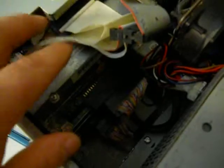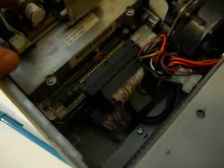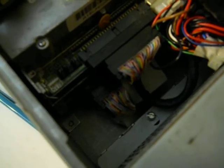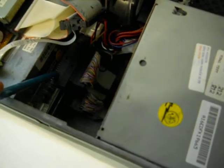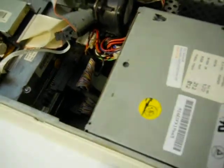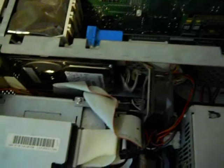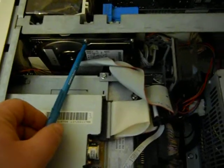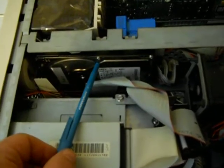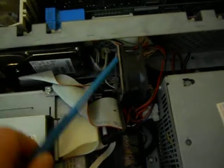Of course we've got the SCSI for the CD-ROM drive, and then below that the SCSI for the tape drive. It all comes out in 50-pin connectors, which go to a 68-pin to 50-pin connector. For at least right now, I've got a single 9GB — I believe 7200 RPM drive — 68-pin SCSI 2, I believe.